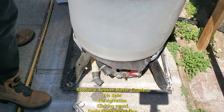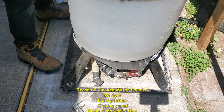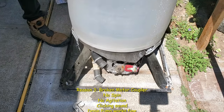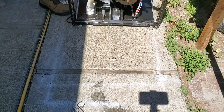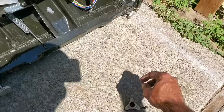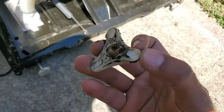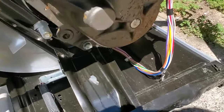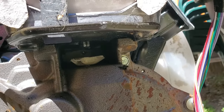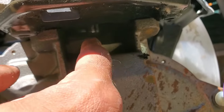For the third reason your machine's not spinning, it's the motor coupler. We're going to put it on its back. And I believe we found out why this particular one's not spinning. That piece — this is part of the coupler. This couples the motor to the transmission. Let's see if I can spin this — yep, there it is. Looks like the coupler here is broken.